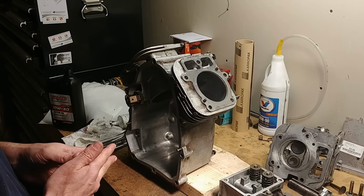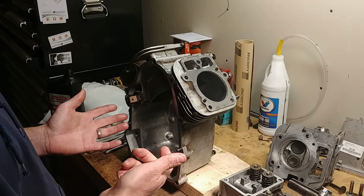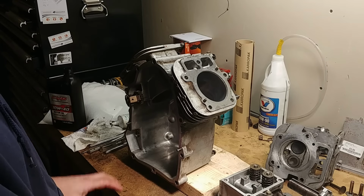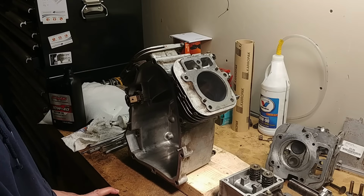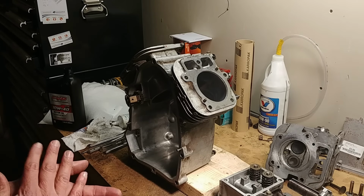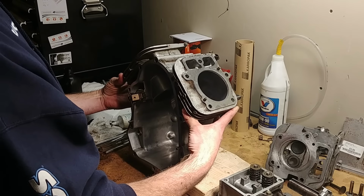It helps seat them so that you don't have high oil consumption, low compression, you name it. After I honed it, those surface scratches are still somewhat visible in the one cylinder, but my general rule of thumb is if you can't catch your fingernail on it, it's probably in the sub 5/1000ths of an inch range, so they're not going to cause any issue. Now, if there's a gouge, yeah, you're going to have excessive oil consumption, low compression, low power. It may run, but it may not be ideal. So this one I deemed as still acceptable. The block wasn't worth tossing. So we've cleaned it all up. Everything is cleaned out inside, and now we're ready to do some assembly.